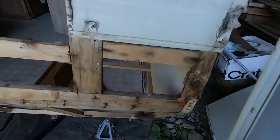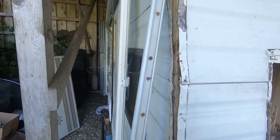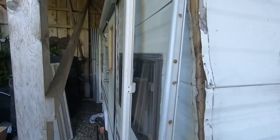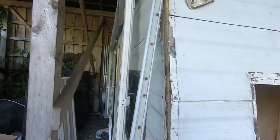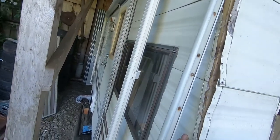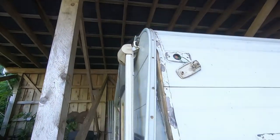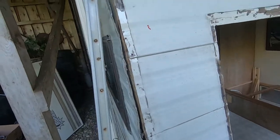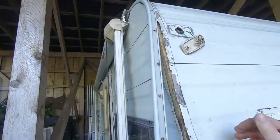This side's about the same, eh? In that same area. Remember on the inside, the plywood was all wet. It's amazing to think it comes out of the factory and they put two pieces of metal together. They have the technology to create one of these pieces with an overlap instead of butting them up like that. That's what a guy in the backyard like me would do. You'd think a factory could create an L shape on the one piece, so it laps over, especially on the front. Wouldn't that be so easy? No, they just cut it off, and then everything relies on this stupid little piece of trim. That's the sign of a bad craftsman, someone who relies on the caulking. The design should prevent the leaks, and the caulking is more of an insurance, not the primary leak stop.